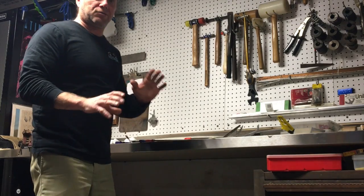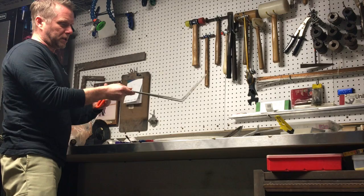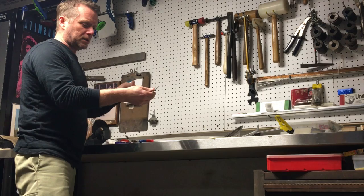Okay, Troy, I saw the picture that you put on and the tools that you're using, that you tried with to do body line dents. This is the one I definitely identified. I thought actually it was this one. Two dent craft tools that I own — I thought I would use a lot. I really don't use them at all. And I would never approach a body line dent with either one of these tools. I think this is the one you have pictured because of the color of the handle. It's too thin, number one.